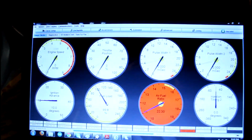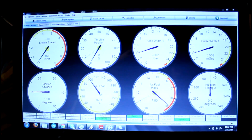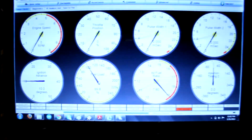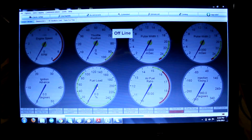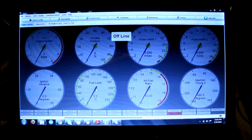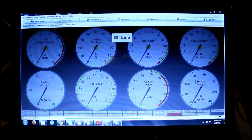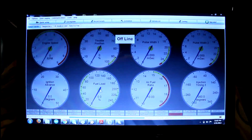I'm going to try to crank it up and see if I have RPM now. I do actually have RPM — it was kicking up to about 175 while I was cranking, so all is well there. I think I'm ready to check out spark, then check the timing, and probably start it up once I get the fuel system finished up and get some coolant in it. But it's ready to go after that.